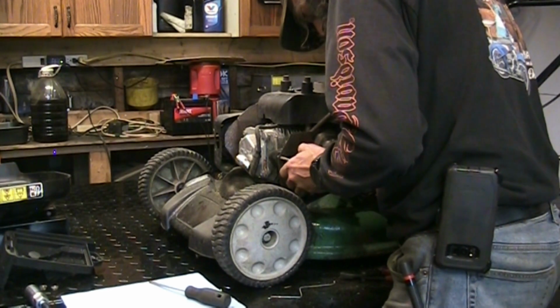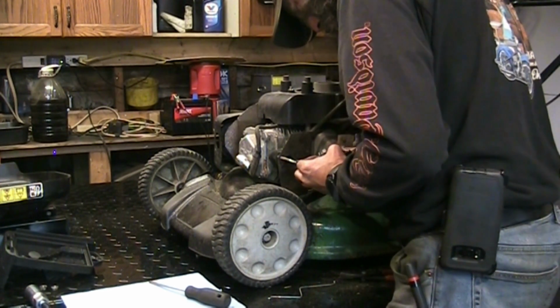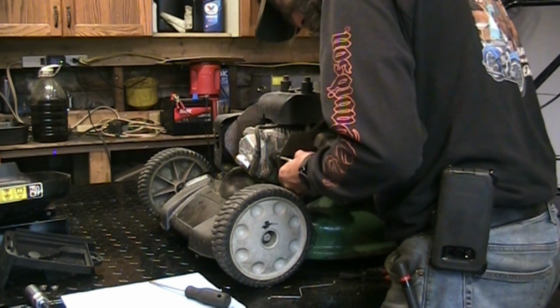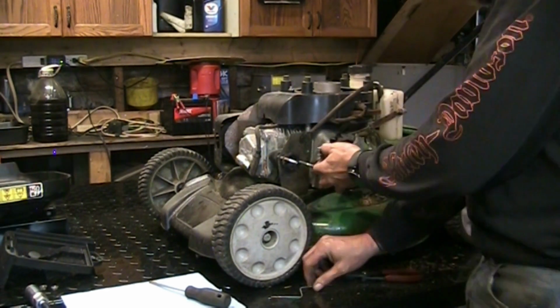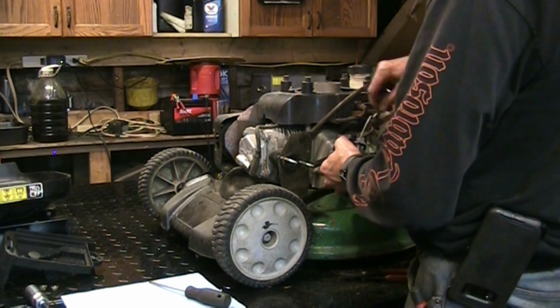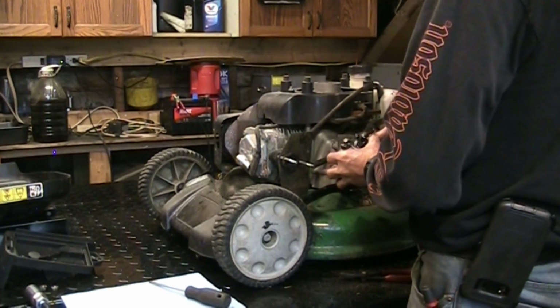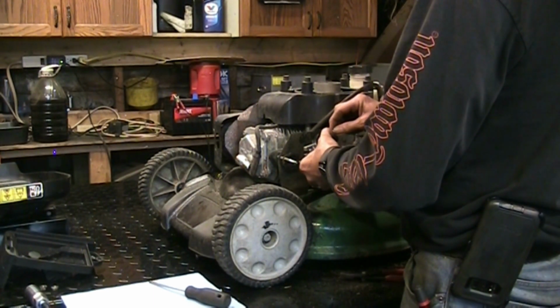There we are. No, we're not. Come on now. Smarten up. That's the way the gasket goes. Pop that on first. We still need to get our throttle linkage in there. Z bend there. Z bend on this end. Get our governor spring on it.